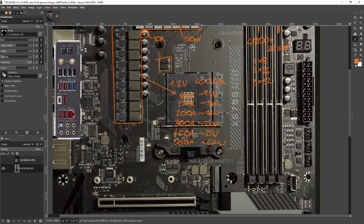This board has a clock gen, which is a really cool feature if it didn't have an X570 chipset. I don't know why Gigabyte doesn't just take this and give me this, but with a B550 chipset. And that's not the B550 Master, because the B550 Master doesn't have a clock gen, and it has the stupid dual BIOS implementation. Gigabyte is just doing what they usually do: technically, they have my favorite combination of features for an AM4 motherboard scattered across 3 different boards, which is just, good job, guys. Seriously, great job. Can you not put these all on one motherboard instead of 3 different ones, each with their own downsides?